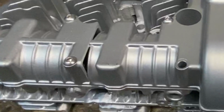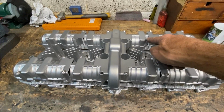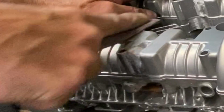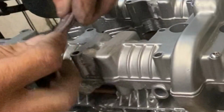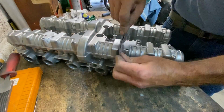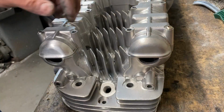With the milling complete, I bolt all the pieces in place so you can see where I have to weld now. So it's just a case of welding around with my TIG welder and then dressing down the welds with some grey coarse Abranet cloth and files to make it all blend in nice and be smooth. I really enjoy this part, going around deburring all the welds and blending it all in to make it look like it's not been welded.